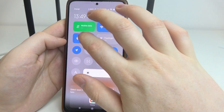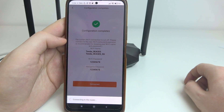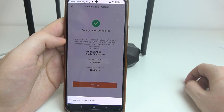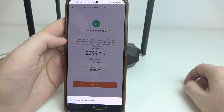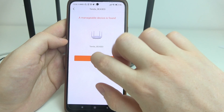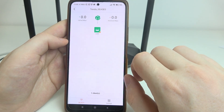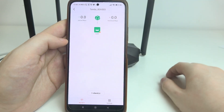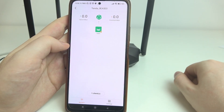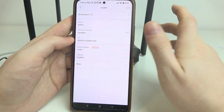Turn off Bluetooth and try again. Go back one step and click on the router. Enter the admin password — it should be the one we set, like 12345678. And here's our router. As you just saw, if you encounter a problem where it keeps saying the router connection failed, just go back and reopen your router and it should work fine. That's it for this video — hope you liked it, please consider subscribing to our channel and leave a like and a comment below.